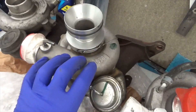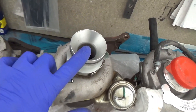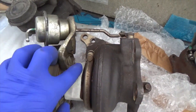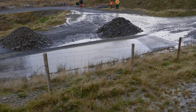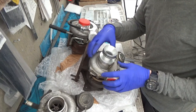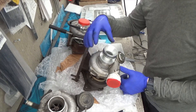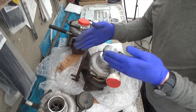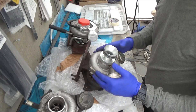This one in the middle is an IHI VF36 turbo. It's currently fitted with a Group N restrictor. I am unsure if this turbo has been fitted with the Owen Developments heat shield, however this turbo was running perfectly fine when it came off the car. The main benefit of going for this IHI turbo is that it is a twin scroll turbo. In a twin scroll you get less lag, as the turbine sequences exhaust gases there is less resistance as they go through the turbo. This allows the turbo to spool up a lot faster.